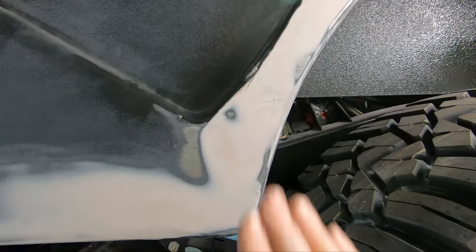If you can see solid lines, if you can see rough patches where your filler still has the surface imperfections, it's low there, and you need to add a little bit more, sand her down. So you build it up, sand it down, build it up, and sand it down until you just want to throw the thing away, and then you've just about got one more pass to do. So that's where we're at. I'll come back in a while and show you how it looks after the next round.